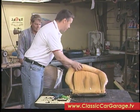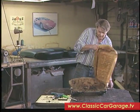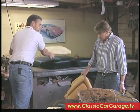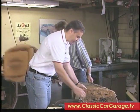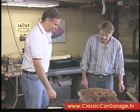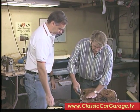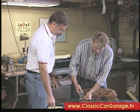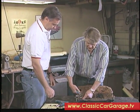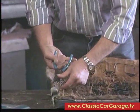Not to worry, because we have new seat buns for this — here's what the new ones look like. We'll toss the old ones out. Now that we're down to this point, the old burlap's got to go too. We want to put new burlap or material to cover the springs so that the new pad doesn't sink back through the springs, and those are held on by hog rings as well, so we'll cut those off.